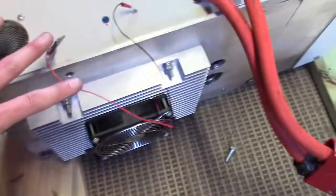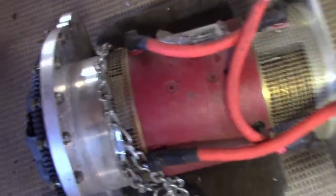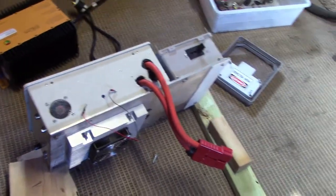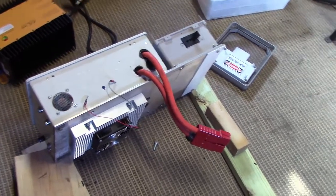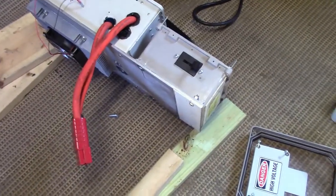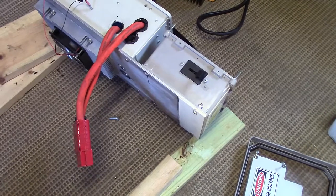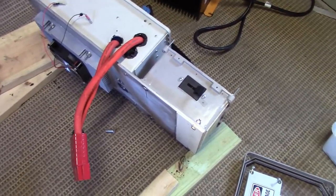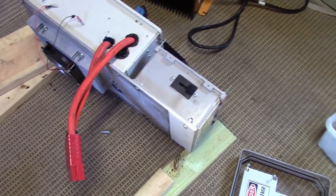The main muffin fan here was keeping the heat sink cool. This was right over the motor, so the motor itself has its own internal cooling when it spins — there are basically fans built in; it's an air-cooled electric motor as well. It never overheated, never had any thermal issues. The controller has thermal protection built in and I never had any problems with it. In my next build — my VW bus build — if I use this situation again, I'll probably just re-envision it and make it a little bit better.